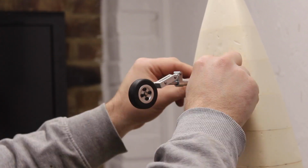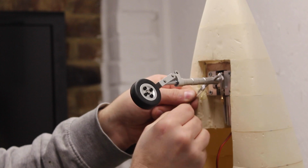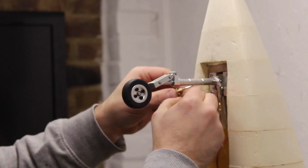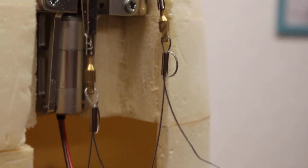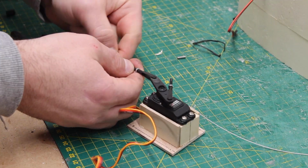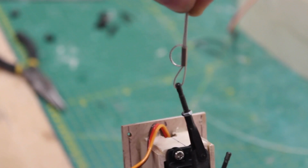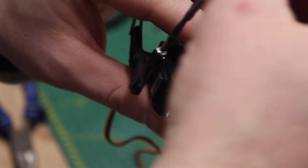The supplied cable is fed through a crush tube and then through the linkage end, and then back through the tube. The end is then looped back up and through the tube once more. Once crimped, there should be 3 passes of cable clamped in the tube. After crimping, some heat shrink covers it all.